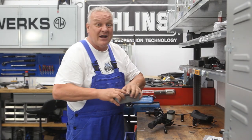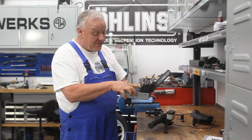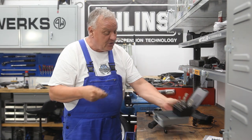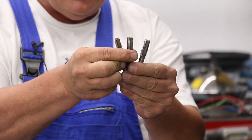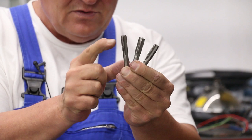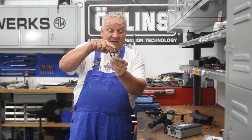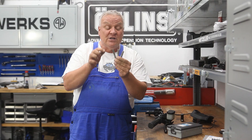I just want to point out this really cool kit that I came across some time ago. It goes M3 through M12 — it's a tap set for tapping holes. You could probably see it best with the larger one. This is a progressive tap system, so you can see how the first stage has a very shallow cut — it basically puts in a very thin thread. Then you pass the second stage through, which cuts a little bit deeper, and finally the third stage gives you a really good cut.